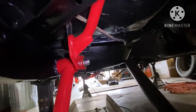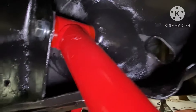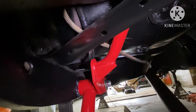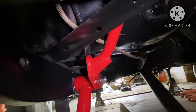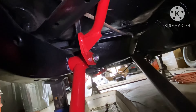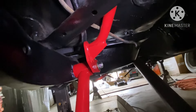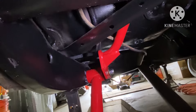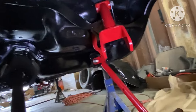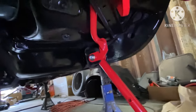Alright gang, we back — going ahead and putting the control arms in there. As you can see, got my little brace come up and hook up at the top trailing arm. Got a broken brake line — I'm gonna cut that line back and make a repair on it. I'm gonna flare it and put a coupler in between. I don't want to pull the whole line out — it's good towards the back, so I'll just cut it, flare it, add another piece, and bring it back up to the top.